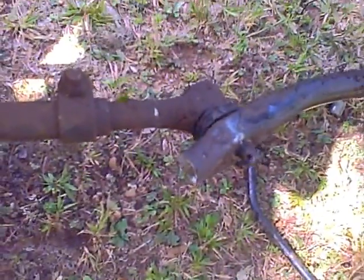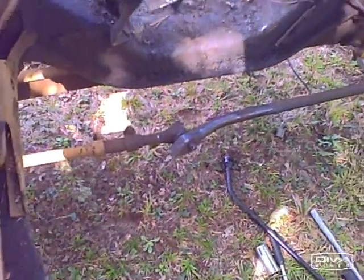I had to cut part of the steering, which I didn't want to do, but I barely rode a bolt and the joint kind of melted together somehow over time. I tried hitting it with a sledgehammer and I couldn't get it apart after I took the bolt off. That was some of the thickest areas I couldn't really cut through, so I had to cut through there. I guess I'm not going to be able to save a lot of the steering sway bars and whatnot, but eh.